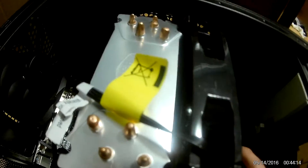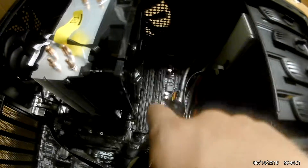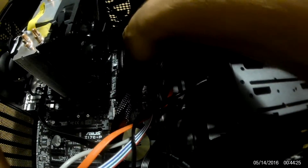So we're going to show you how to install a piece of RAM. I'm going to install it into the middle slot — the first stick into this middle slot right here. The manual for your motherboard will tell you where to install it if you're not sure. But in most cases, you install it in the middle row.